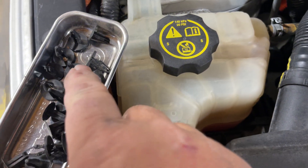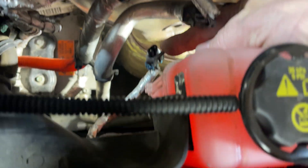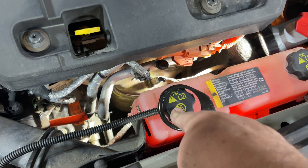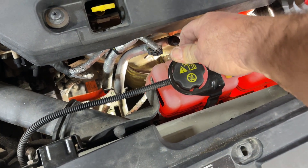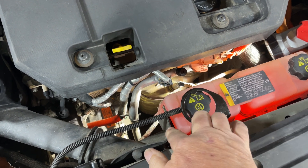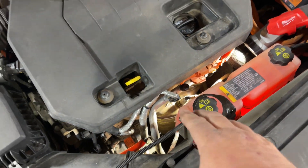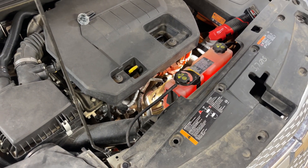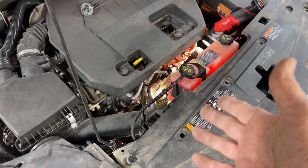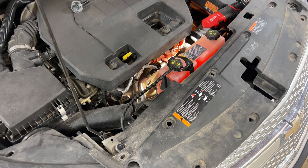I just took these pins out right here. You can see the electrical connection right there. The sensor actually goes underneath, down in here, so you have to jam your hand in there — that's why I couldn't show it on camera. If you get a code for service high voltage, check this coolant. It should be above this bracket; that's where mine likes to run. This is a DIY job — you can do it, it's not that hard. It just pries out and I really didn't use any tools except a small pry tool to get the pins out.